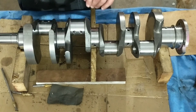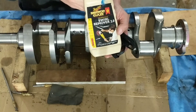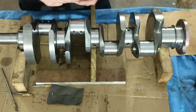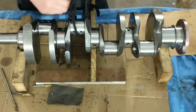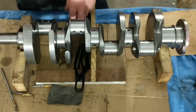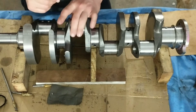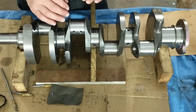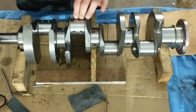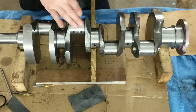After that is complete, I will get a shoelace and put some swirl remover on it. I just kind of spread the swirl remover in and clump it together, then wrap it around the journal and give it a couple of passes to basically just polish the surface. Now, this is not gonna give you a mirror finish unless you really work at it. I just made a few passes — this journal, between sanding it with the 600, going to 1,500, and polishing it with the shoelace, I probably have maybe 10 minutes into it.